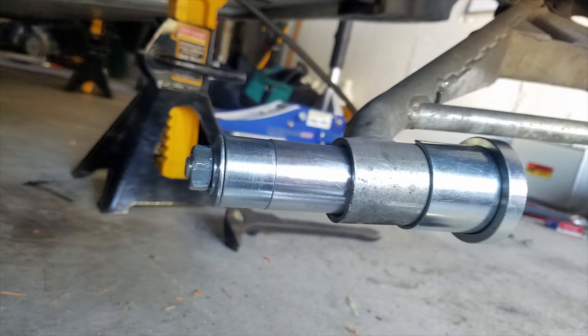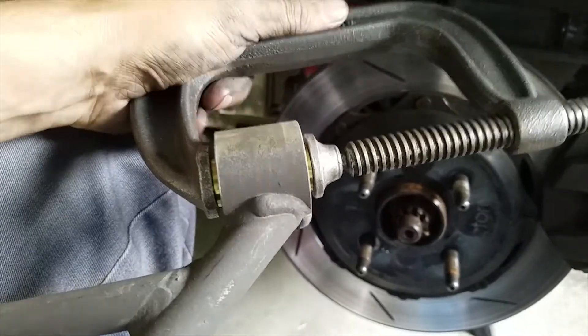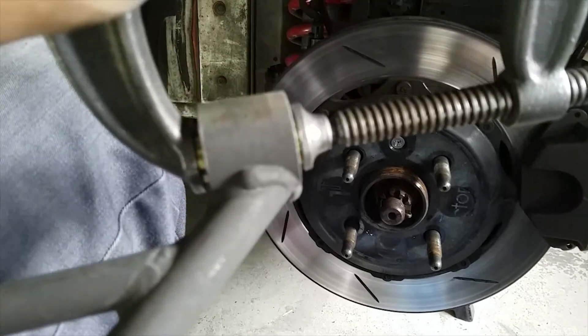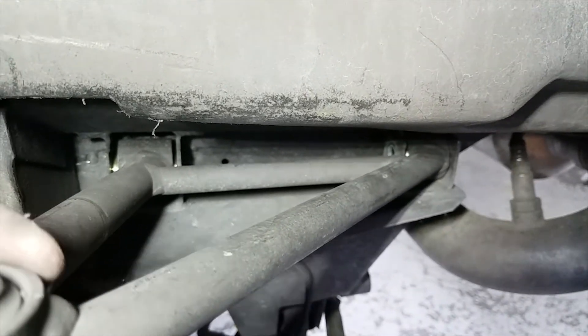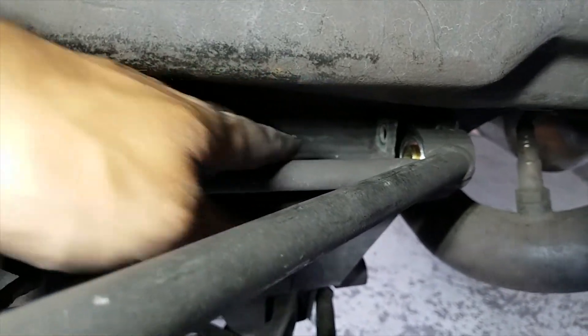I replaced it with a 10.9 grade bolt, and I chose one that was 150mm long — that length handles all of the bushings, including the longer one on the forward lower rear of the A-arms. Once the bushing is inserted, clamp it and rotate it a little to ensure there's no gap on the interior. The gold parts can sometimes migrate outward slightly, so once the monoballs are in, the A-arm should slide back into place pretty easily. If it doesn't, it means one of the brass pieces has wandered out and needs to be pressed back into the monoball.